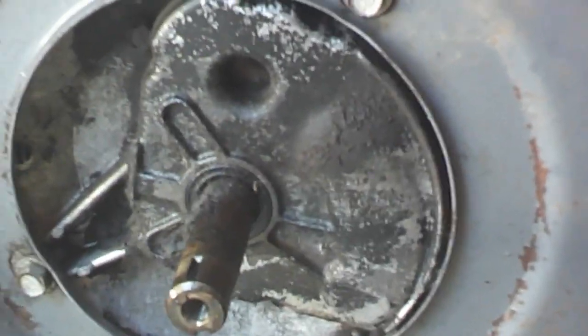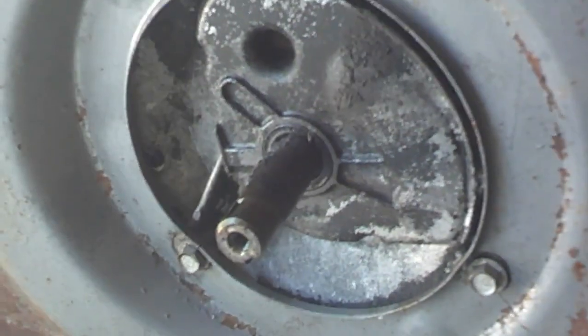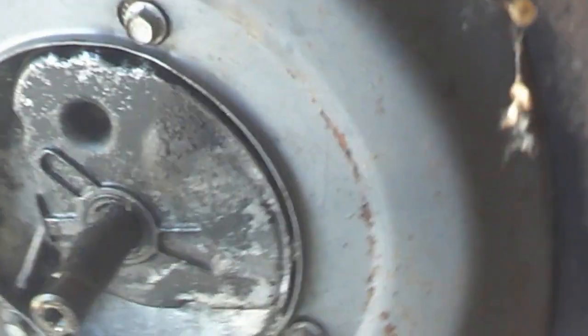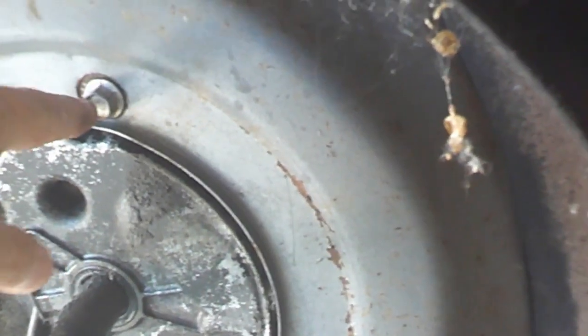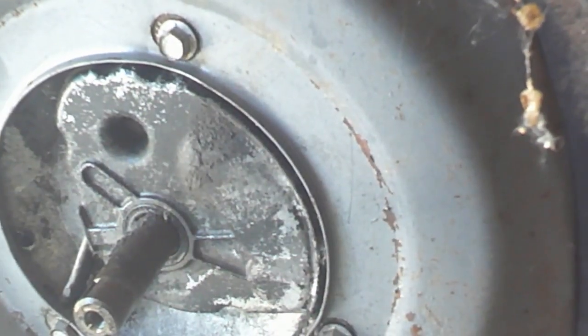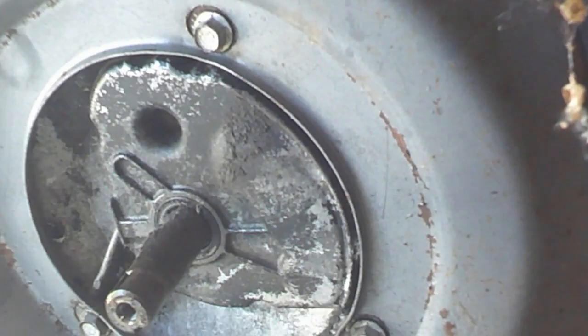And it seems like there was a lot of oil under this thing too. I don't know if that seal is out or what's going on. But I got a feeling that bent blade probably caused this thing to vibrate pretty bad, and that probably caused these things to get loose. All these bolts, you can see the witness marks, so that's going to be a bad thing. That is if the crankshaft isn't bent. Yippee!